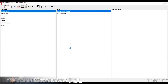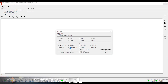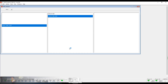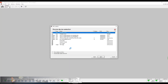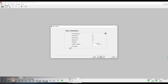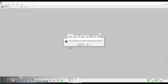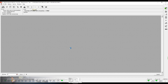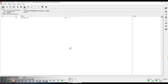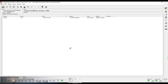Once that's done we move over to the PC3000 software. First, power on both drives. I'm going to connect the utility just in case I have to deal with the heads later — I don't expect the heads to be bad but I'll set it up just in case. Then choose the source drive, select data copy, choose the destination, and start the imaging. I'm not going to build a head map right now since I didn't swap the heads.